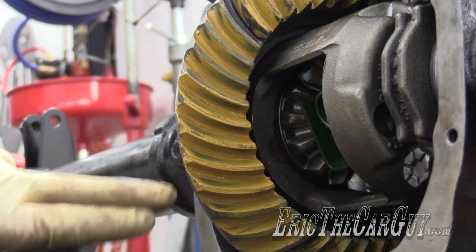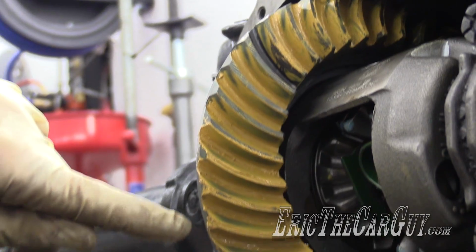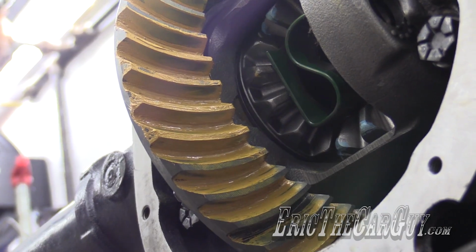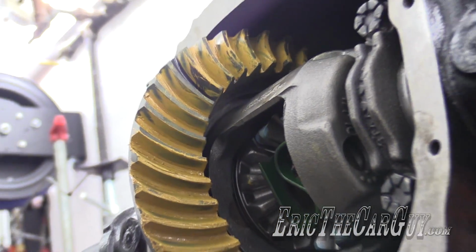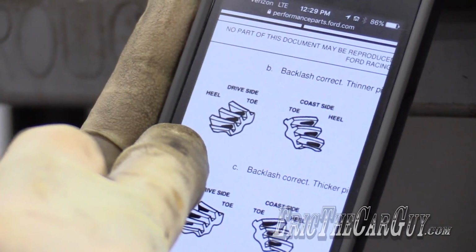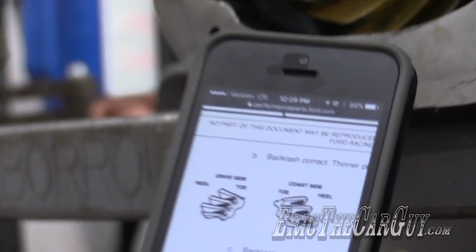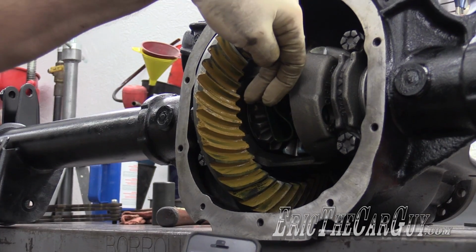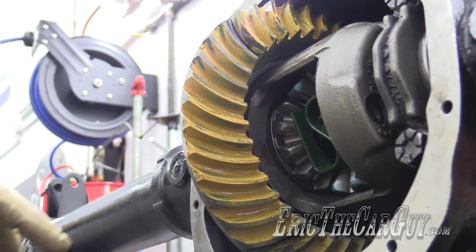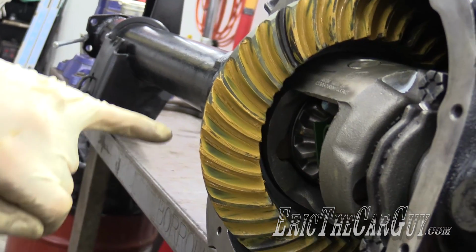Now there's my pattern, which is nice and thin, as opposed to the sharp edges that I had on my old pattern. So the fact that it's softened out like this and it's spread out over a wider area is very encouraging. That being said, I have the Ford PDF manual about this, which I'll post a link to in the description for doing this assembly, and looking at this tooth contact pattern, it looks like what I have is here, where on the drive side, I'm down in towards the toe, as you can see here, on the drive side. And then on the coast side, I'm out towards the heel, which is here, like this.